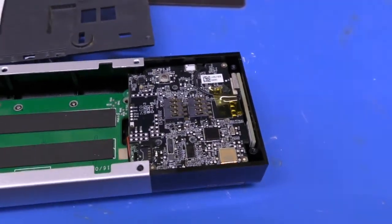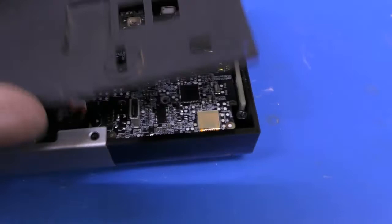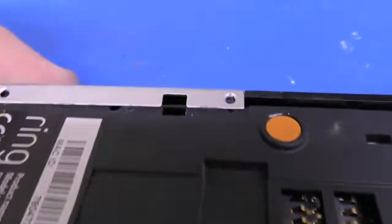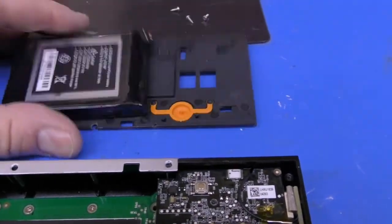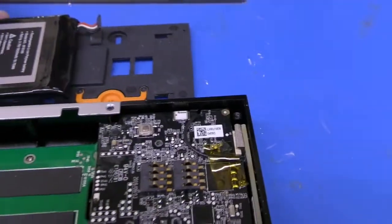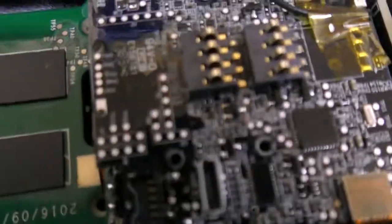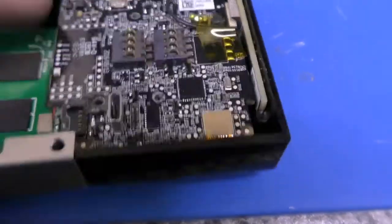I've managed to undo the screws and used a little tool just to prise the aluminium back on both sides, so I could eventually free up the plastic. The plastic actually tucks underneath it like that — you can bend the aluminium out far enough to lift out this back panel, which has the battery stuck to it, with just a connector holding the battery in place. That's probably going to be a bit tricky to put back in. I noticed a little bit of corrosion on the battery connector — I've cleaned it off now.